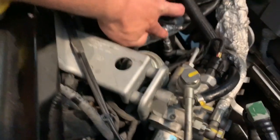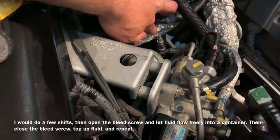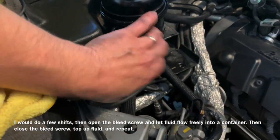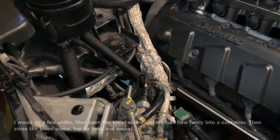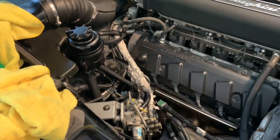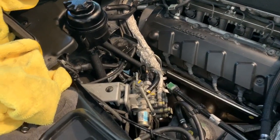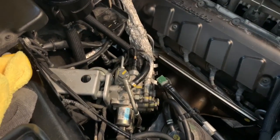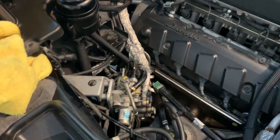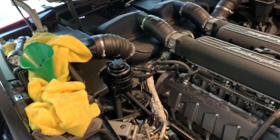After doing the vacuum pump, I also let it gravity bleed. I would do some shifts in the car, take the key back out of the ignition, crack the bleed screw again, let fluid flow, make sure that you're topped up, and I probably did that about five times until there are no air bubbles coming out. It's worth noting it's impossible to pull that accumulator out without leaking anything — you will drip fluid. Because I dripped hydraulic fluid and it's flammable just like engine oil, I went ahead and sprayed everything down with soapy water and wiped things up as best I could.